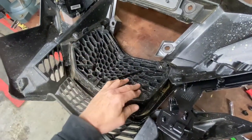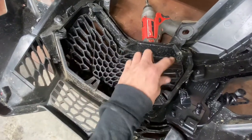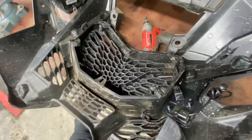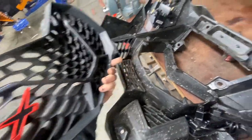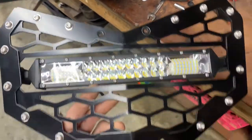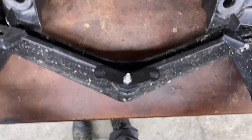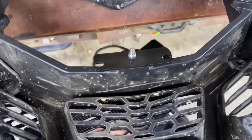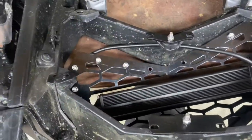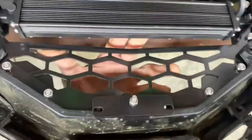Then go ahead and worry about taking your grill off. For the grill changeout, there's a T20 on both sides and just these little clips - push on them and it'll pop out, though they're incredibly tight. Put in your new grill: take the two center bolts out on top and bottom, and they provide you with some extra longer bolts. Take your little brackets - one goes on the bottom, one goes on the top. It's plastic so just get it snug and you'll be able to wiggle it around to get it centered. Put your grill up in there, the holes line up, it basically pinches it to the plastic, and your grill is mounted.